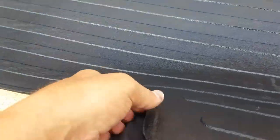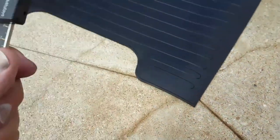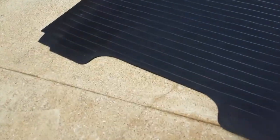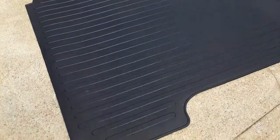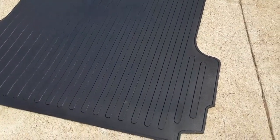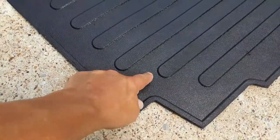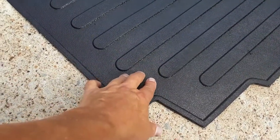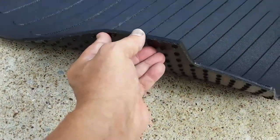This part where it drops down is going to be even thinner. That's not necessarily that bad, but just be aware that when they say three-eighths of an inch thick, that is the thickest part of the bed liner. It would be more ethical if the measurement they gave you was for the main flat part of the mat, rather than the very thickest point which includes the little dimples.